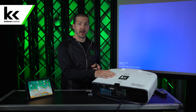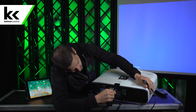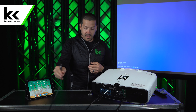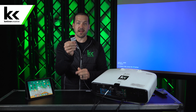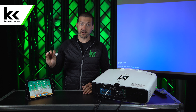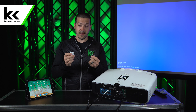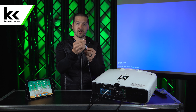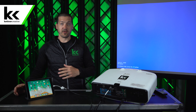So we can see that the projector is turned on. What we're going to do is plug the HDMI cable into the projector. And right here is the official Apple Lightning to HDMI cable — this is the adapter you're going to need to get video signal from your iPad to your projector. So we connect the HDMI cable to the adapter and then plug it in. The cable is reversible, so it doesn't matter which way you do it. Now it's plugged into the iPad.